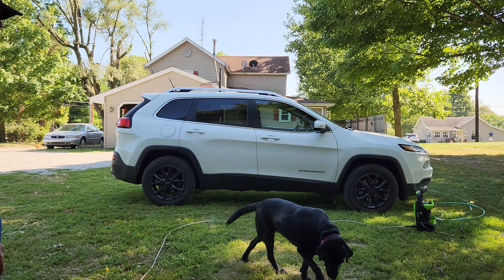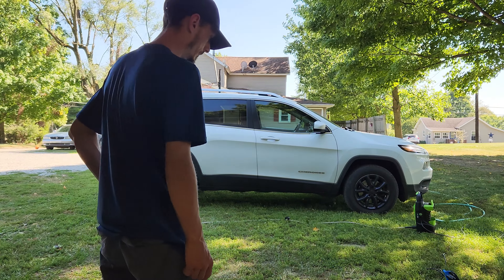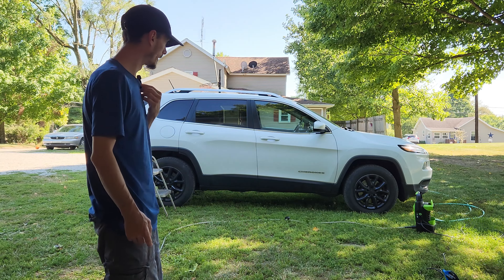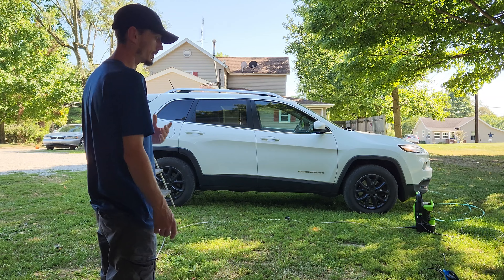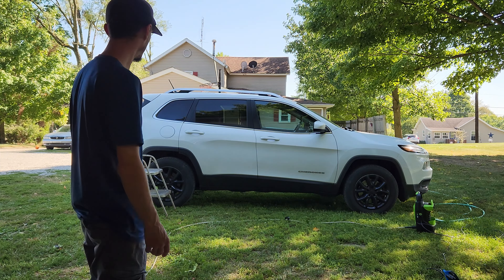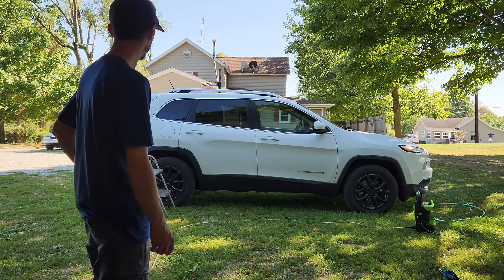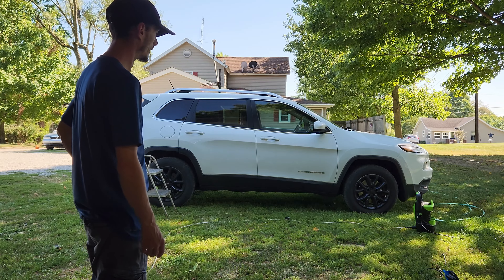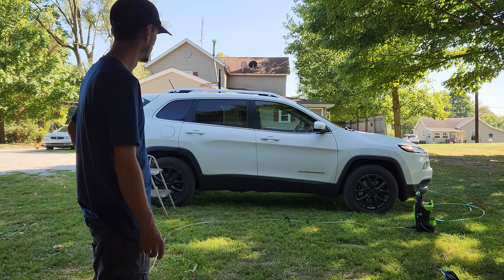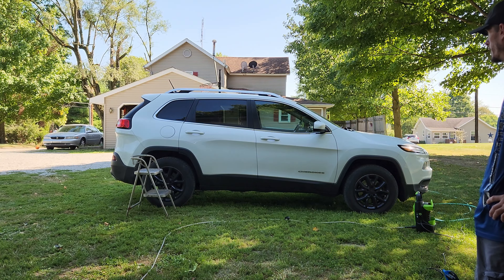I'm going to walk you guys through how I do it. I'm going to hose the car down and knock off as much dirt as we possibly can. I've already got my soap in my bucket, I'm going to add water, and I've got my foam cannon ready to go. The main purpose of this is getting the paint clean. After we're all done we're going to have to wash it again, so I'm not going to scrub the wheels and tires right now because I want to polish the car, buff it out, get all the scratches out of it. Then after we're all done it will get another bath before the paint protection goes on - you've got to make sure you get all the compound off. Right now we're just decontaminating the paint, that is the main goal.